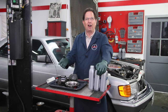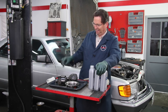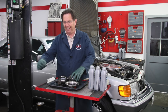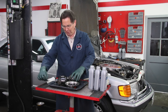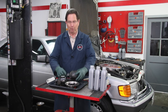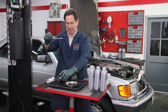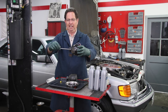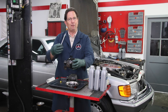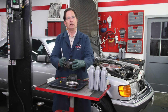Both are off now and this other one's no better. The plastic stick goes almost all the way to the back. The one from the right side goes in this far, and the one from the left side goes in about the same - there's about a half inch difference. But compare that to the new accumulator: the diaphragm is good and it's only going to go in about an inch from the face where the fitting attaches.